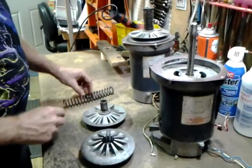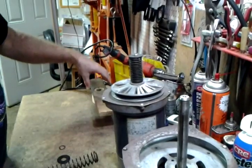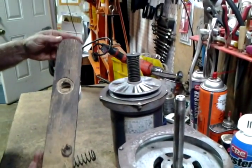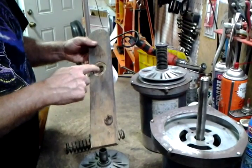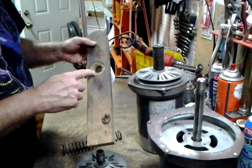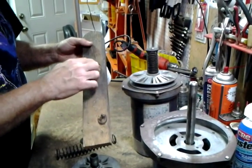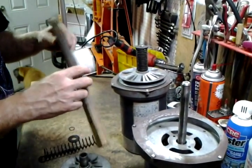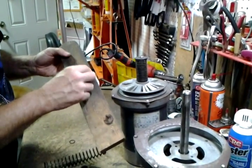And there's a trick to compressing it so that you can install or remove the spring. This is a board I made years and years ago — it's very simple. Just drill a hole that's three-quarters of an inch across, or maybe seven-eighths across. I countersank it on both sides to keep this washer from flying off at me.